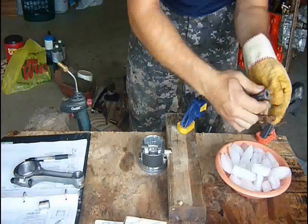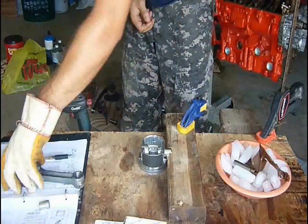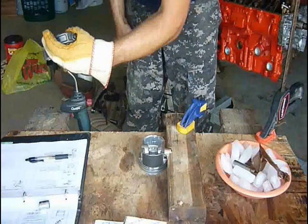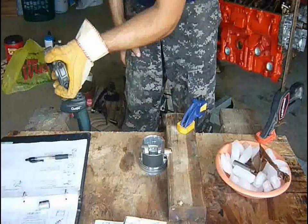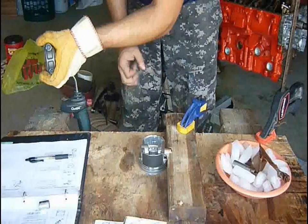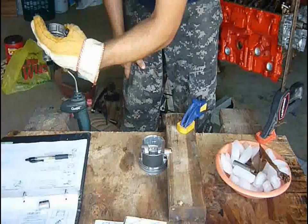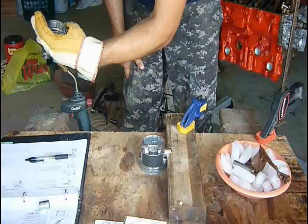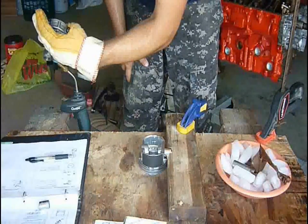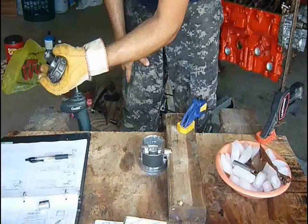You'll have to work fairly quickly because it only takes about two seconds for these to bite. Heat the small end of the rod up — what that does is expand the circle. And whenever you freeze the wrist pin, it compresses the pin itself. So you make the wrist pin smaller, you make the circle larger, and then they push right through. But obviously, whenever the rod heats that wrist pin up, they'll equalize their temperatures and bring them both back down to spec. So you have to do it kind of quick.